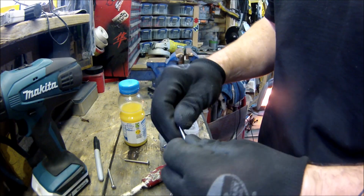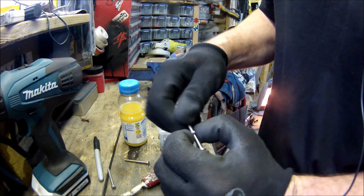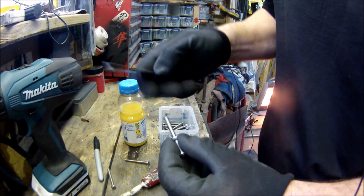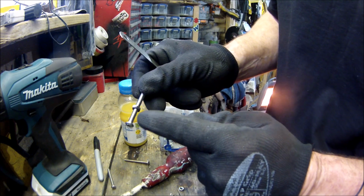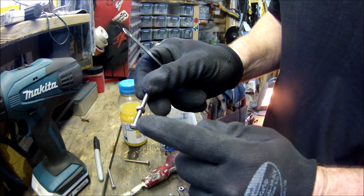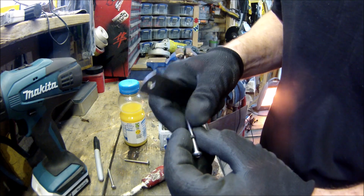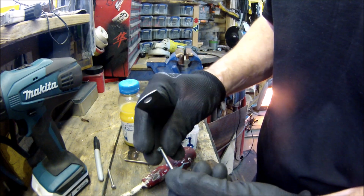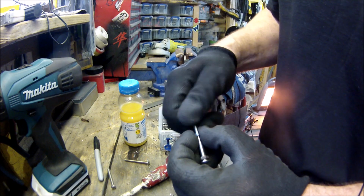So I had a bit of a remeasure on that, because when I went to 30mm on here, there was far too much left just for the battery tray and the sheet metal that I've used to go underneath it. So I had another look and found that I'd left the earth lead for the battery underneath the battery tray, which had boosted it up by 10mm. Ooh. So lucky I checked. Measure twice, cut once, and all that malarkey.